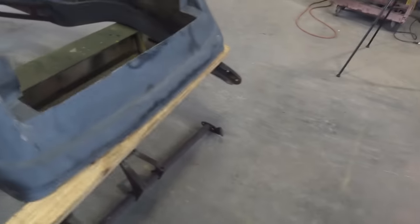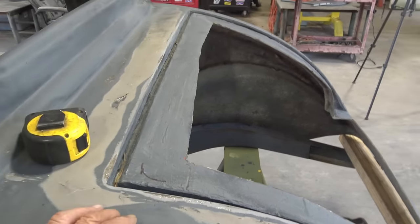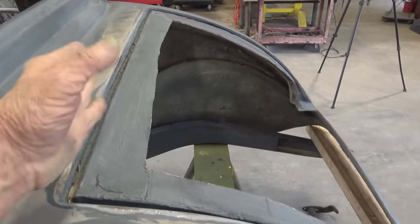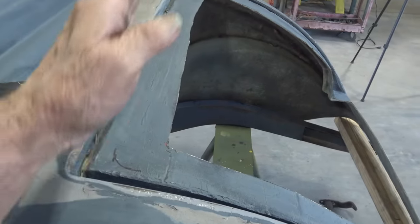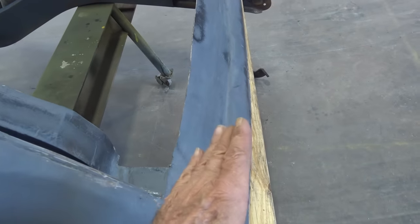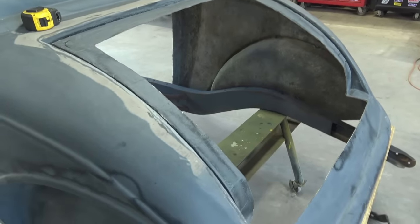because what happens is that top, when you shut it, that lip kind of goes down in that rain gutter a little bit. And being that the trunk lid is backwards, the bottom is at the top and the bottom is angled like that. So when you put the trunk lid on where it fits, this top piece is angled like that instead of straight. So that's a problem. And at the bottom, it should be angled this way, but it's like straight, so yeah. The trunk lid is not for this car. I'm gonna try to make it for this car.